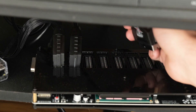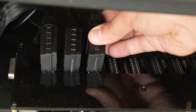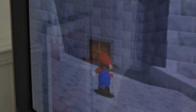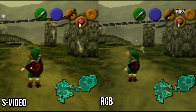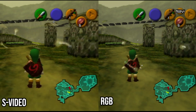I plugged in my Insurrection Industries SCART cable into the system and into the GamesCare SCART switcher and turned it on. The RGB mod was a success, and the SCART switcher automatically selects the input when the console is powered on — and it also looks great. I'd say it looks about as good as S-Video. So if you have S-Video cables like the ones from Insurrection Industries, I don't think this mod necessarily does much for you video-quality-wise. Here's a side-by-side comparison of the N64 fed through a RetroTINK 4K — there's definitely a difference, but I wouldn't even call it better. It's just different.